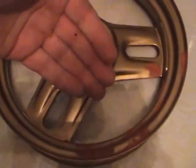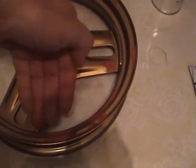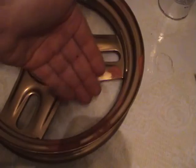the bare paint. And what I'm trying to do is take little spots that I have, little tiny depressions or nicks, you know, things wheels normally get, and I will try and fill them in with the spot putty. And then when I go to sand this off, I'm going to use 2000 wet sand. I should use about 1000, but 2000 doesn't matter as long as you go slow.